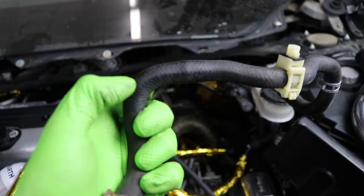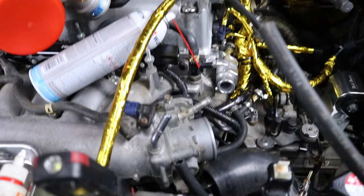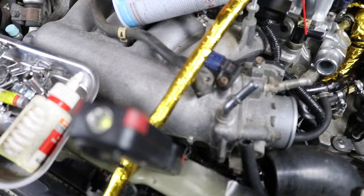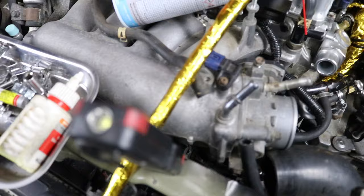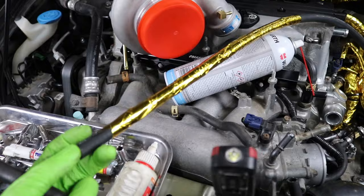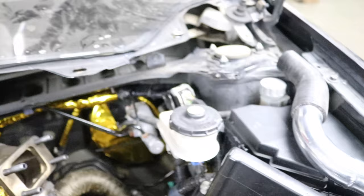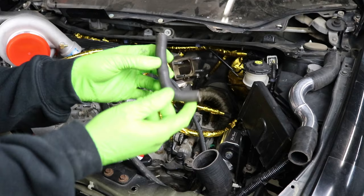We are going to install that in line with our hose that we're building right here. Ideally you want this as close as possible to the master cylinder, but in our situation since we are extending this line so long, it's going to be about two feet away from the master cylinder instead of one foot — right down here by the ECU instead of up over there by that blue clip. So it's a little bit further away, but if we have any issues, we can move it again. I think it's going to be okay.